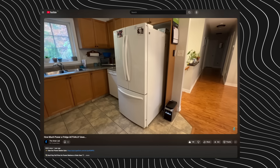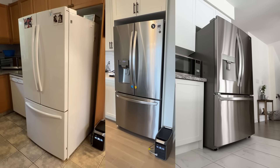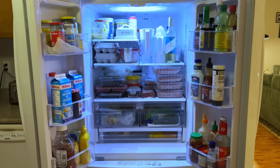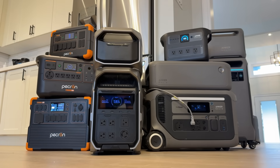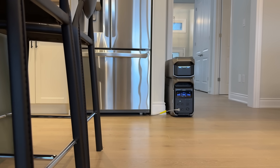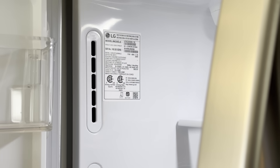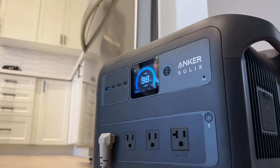We made a video a year ago called how much power does my fridge actually use. In that video, we tested three regular household fridges in three completely different homes and they all measured about 1,300 watt-hours of consumption per day. So basically, if you want to make your fridge last for one day, you need two things: a power station with at least 1,300 watt-hours of battery, and an inverter bigger than the maximum draw of your fridge — that's just the number on the sticker inside. Your fridge might say 300 or 400 watts, but it rarely actually uses that much. Most power stations will have an inverter way bigger than that number, so that part you really don't have to worry about.